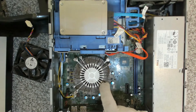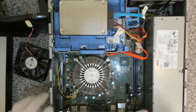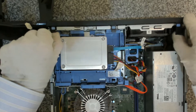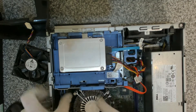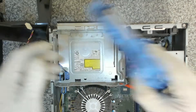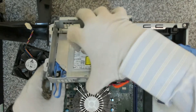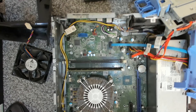As you can see here, we've got quite a lot of dust build-up on that CPU cooler, so we can remove that as well. Inside here we've got our drive cage assembly. By releasing that catch and lifting the front tabs we remove the front panel cover. That's been slid off, releasing the bracket on the side, and that will allow you to lift that up. We can take that drive cage out and then remove the whole assembly.